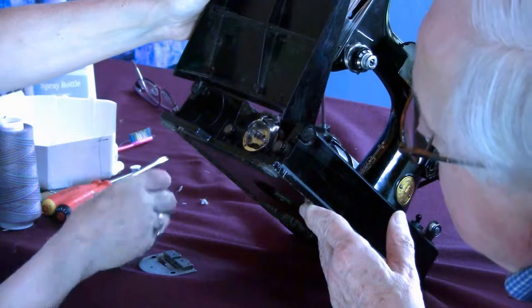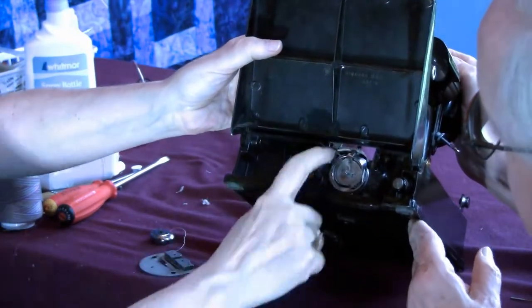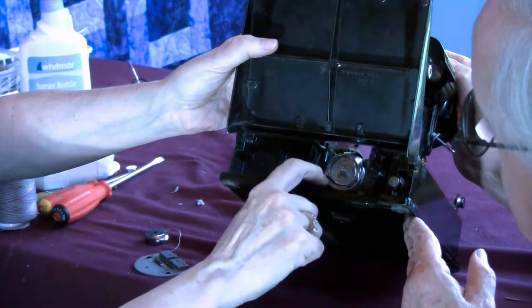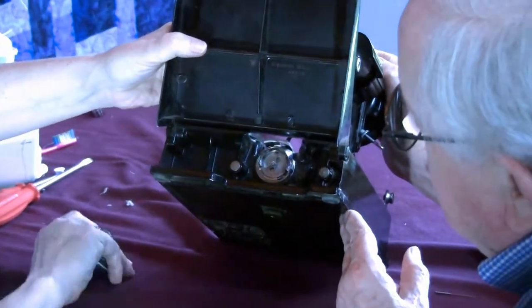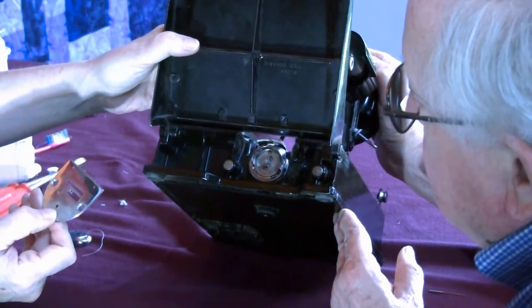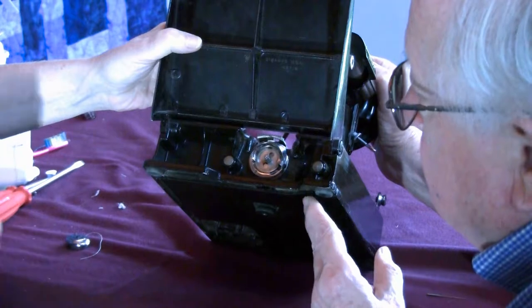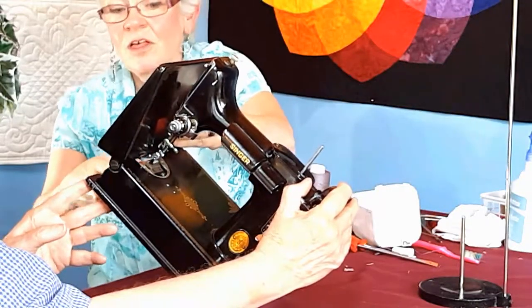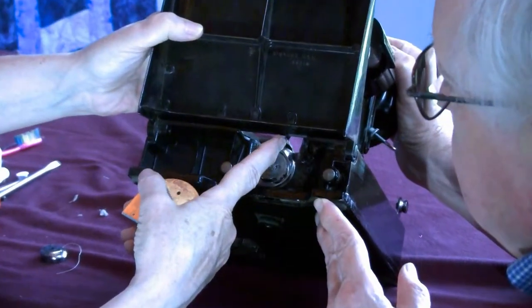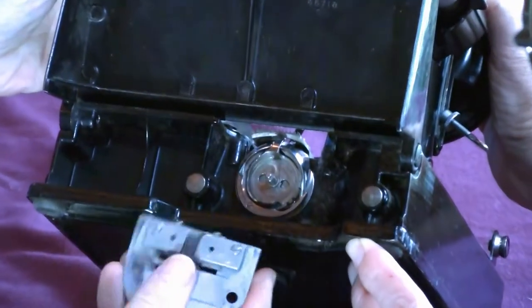I've taken the bobbin case out. Do you see that finger? Mm-hmm. That finger can just spin around, and it doesn't matter where it is, this plate will fit on there. So you clean, it's all shiny, there's no lint, you've done such a wonderful job, but you've missed one important thing. This finger has to be at 12 o'clock because that finger needs to fit in there.